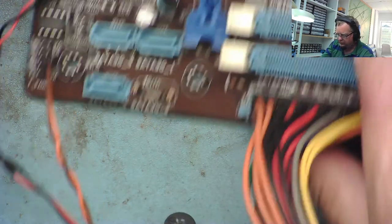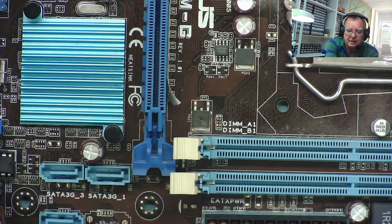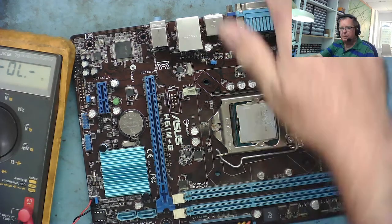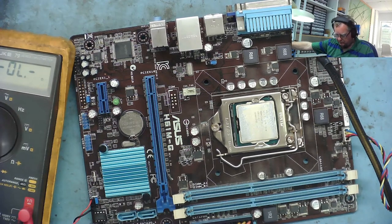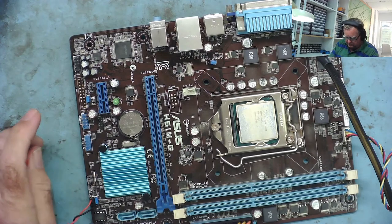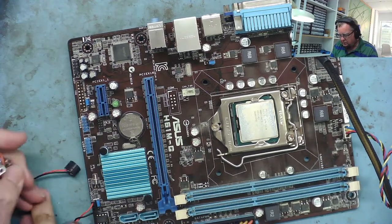Let me zoom that in so you can see it. Yeah, the SATA connector is actually broken. I'll make sure none of the pins are actually touching each other — it looked like the first two were but no, they're not. So there are no shorts there. I'm fairly confident we can replace that connector if that's what the problem was. Let's see if it actually boots up. No point putting a monitor in yet because there's no RAM.